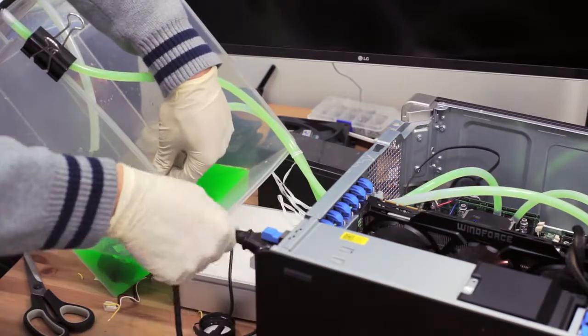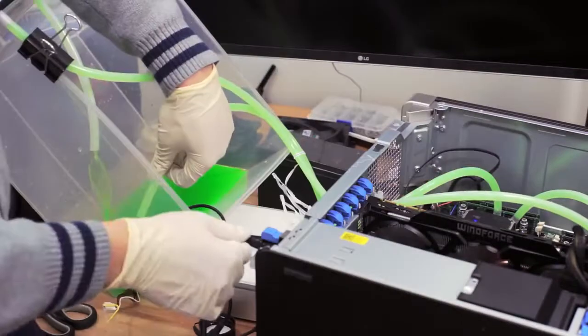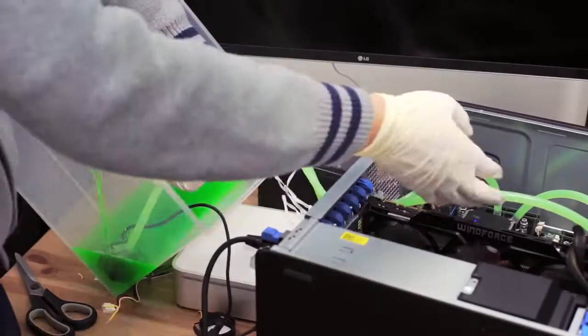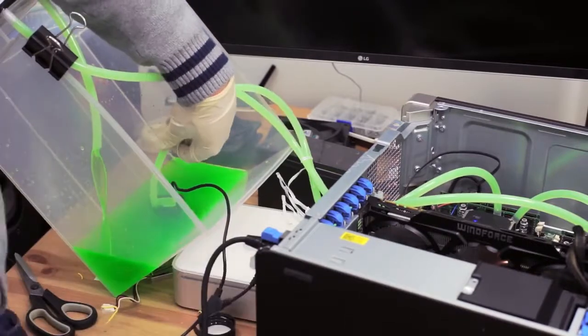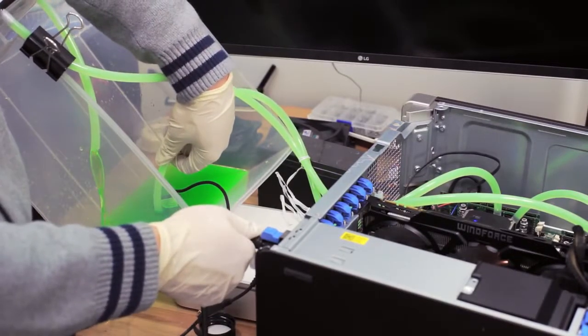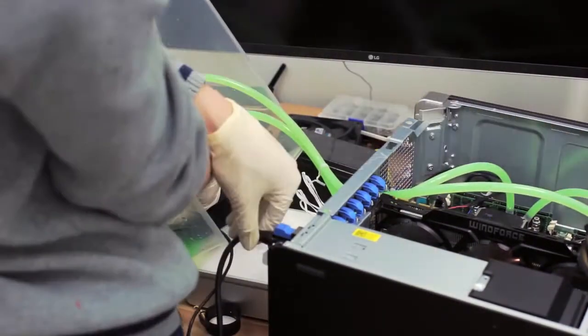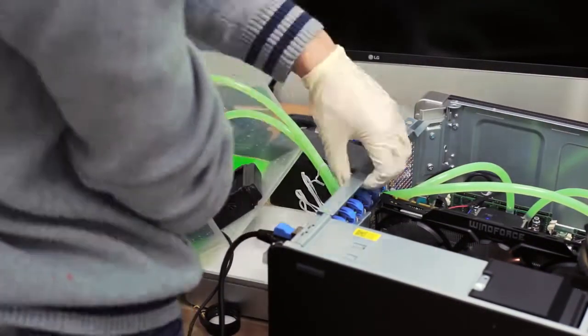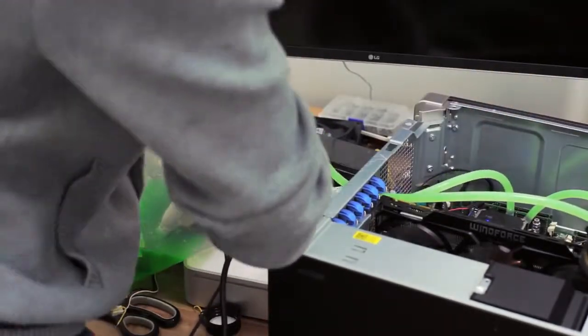After that, I just plugged in the PC and let the two coolant pumps circulate the green liquid until most of the air bubbles disappeared. Restarting the machine a few times seems to help get rid of the remaining air bubbles that refuse to leave. To finish the install, I just submerged the radiator connections in the coolant so that no air would get in, and transferred the free pipe over to it while it was still pumping. I just pushed it on.